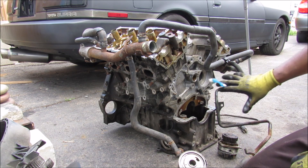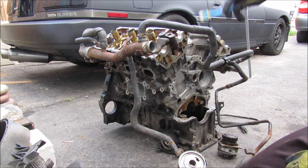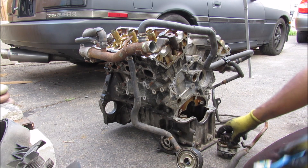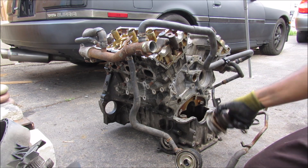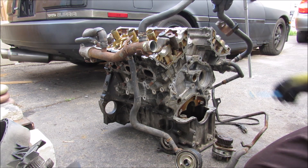Finally we reach the engine block, which is where all the combustion and heat is coming from. We've got the cooling circuit that goes around the engine to cool it off. At the bottom here we have the oil cooler. We've also got the water pump, which is powered by the timing chain, and the thermostat housing, which serves as the water inlet for the coolant.